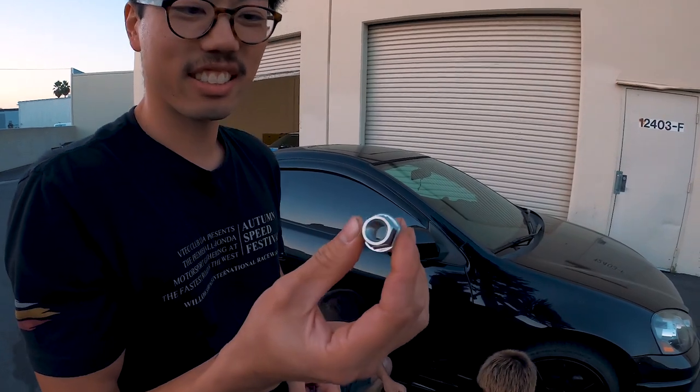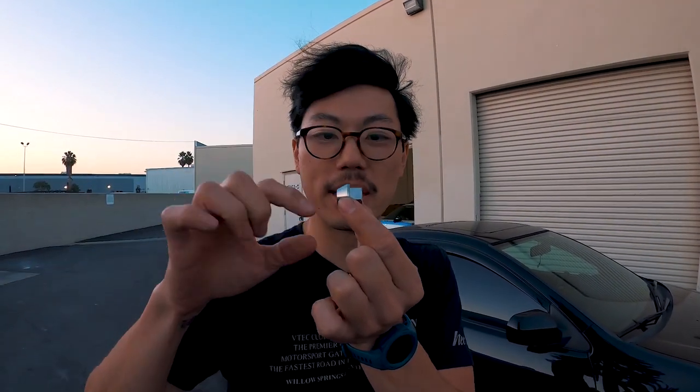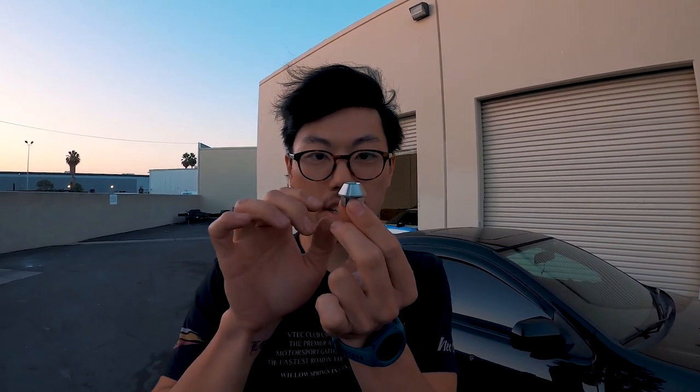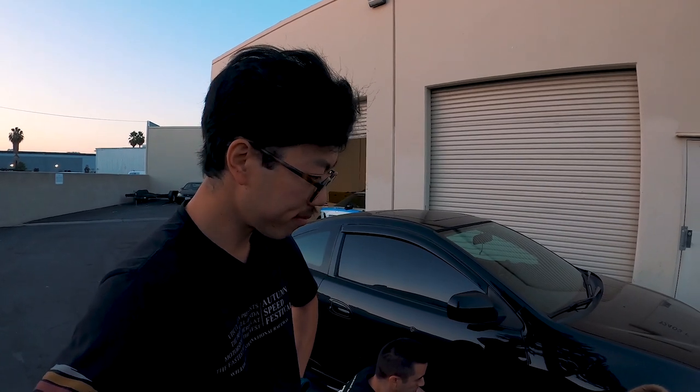It's a 17 millimeter head, grade 5 titanium. It's designed to be as short as possible while still being safe. It has 20 millimeters of thread engagement, plus a 60 degree standard seat, but wider for maximum contact patch and seating. It's trying to be very racing. From what I've seen, it's the lightest on the market at 13.7 grams. Right now it's only available in raw titanium because that purple blue finish is ricer as can be. Race cars don't have that.